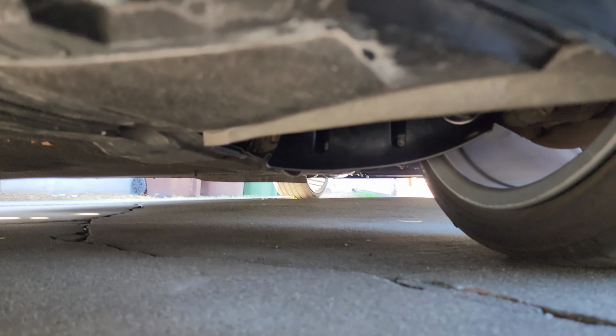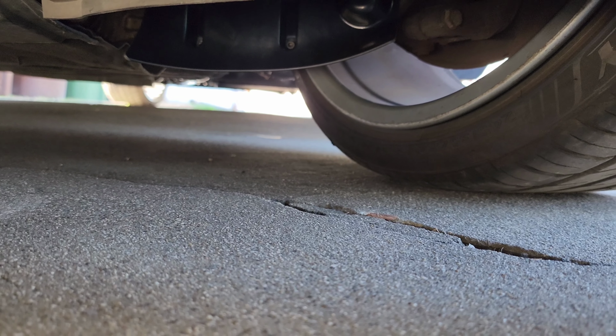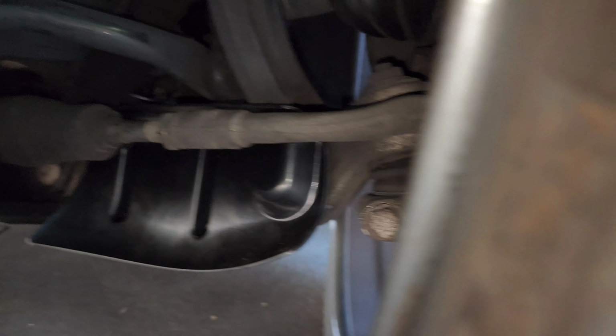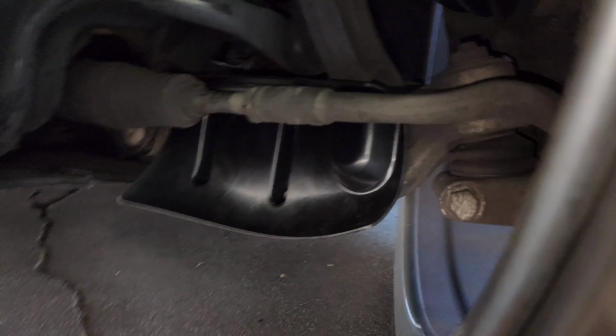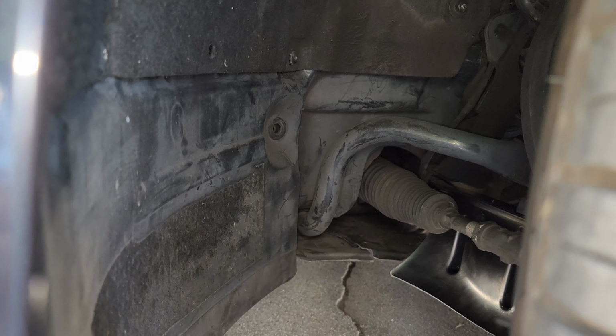I'm actually stitching this part of the video in so you can see how low they sit with the car on the ground. It almost looks like it's flush with that, barely sitting up, but it looks like it's enough because of the way the scoop moves forward to scoop all that air in. But if you look at the fender well here, if you were to put some holes or louvers in that, it'll direct even more air at the scoop. So I might do that later. There are usually, like on the S or RS6 version, a higher version of a lower version car, they'll have vents in them already. So I'll check on that, or else I'll probably just put some vents or something in the fender well to get more air.